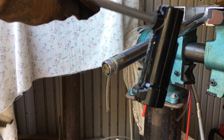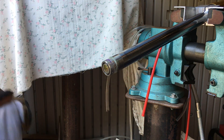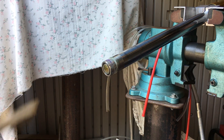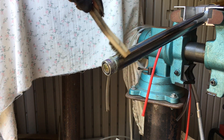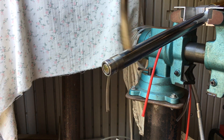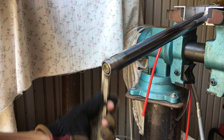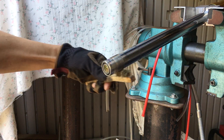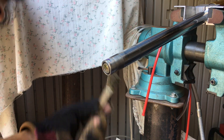From here, I'm going to leave the bolt on a surface to cool down — don't touch this stuff. I have a brass wire brush, and I'm going to use it to clean up the Loctite residue so it's completely cleaned off. Use brass — don't use steel or stainless steel — because brass is soft so it doesn't scratch your fork. See how it's all powdery? That's when you know the Loctite got heated up enough where it basically broke down. Everything here is still real hot, so be mindful of that. Looks like it's pretty clean.